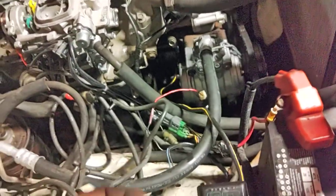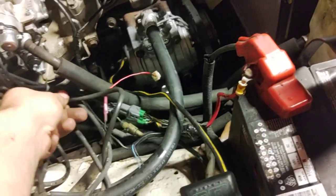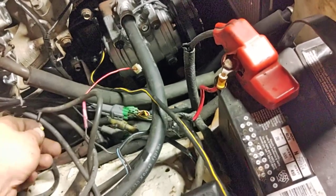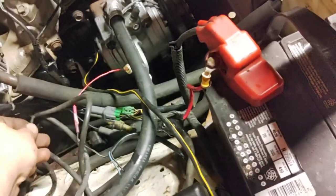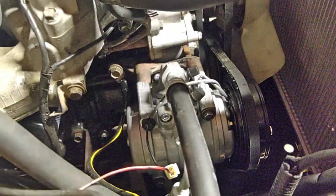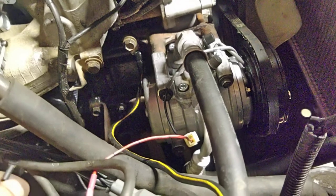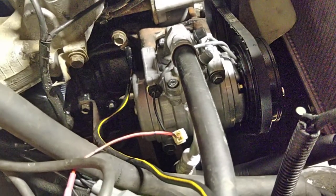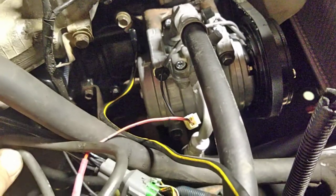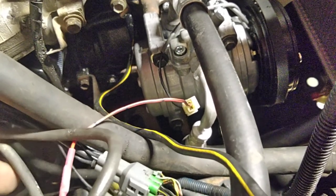So we plug these vacuum loops and fire her up — and it cools. For these R12 systems you can put the adapter fittings on, which is how you're supposed to do it. The big line there — the one further towards the engine block — that is the low-side AC service port. The high-side port, which is the red one, is the one further towards the center, which is a small line. The blue hose goes on the low side and the red one goes on the high side, because the high side is the high-pressure side after the compressor has built pressure.